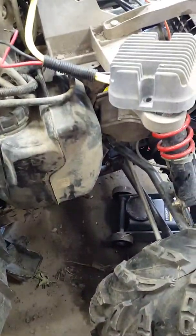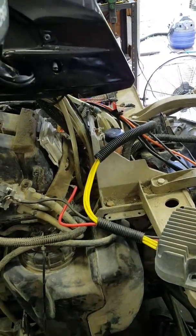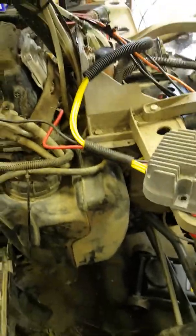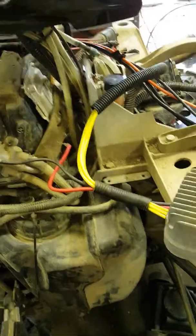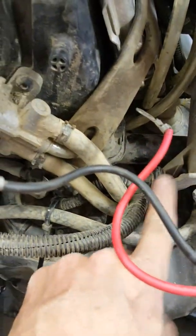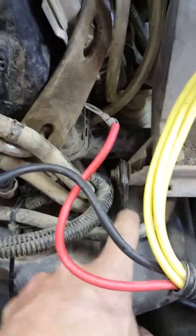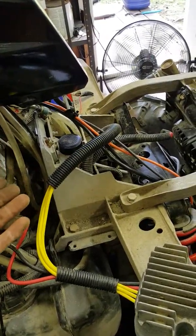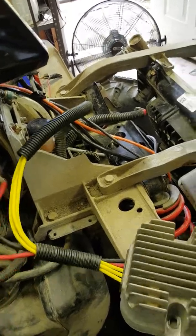You do need a friend for this. The other thing is the tank — I put the tank in after we put the whole handlebar assembly on with the shaft. You need a friend on the other side because on a 1000 there are so many wires and connectors that it gets caught on the left side clip for the gas tank. You have to have someone push on that side while you lift up all the wiring that sits on top of the tank.